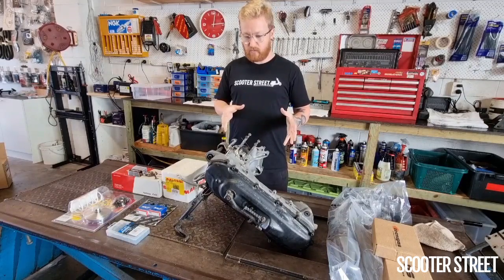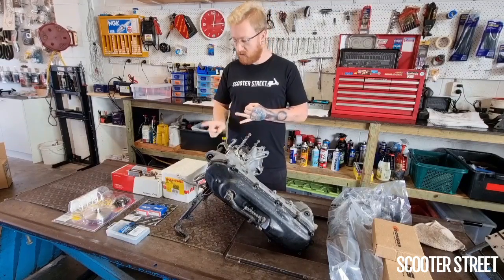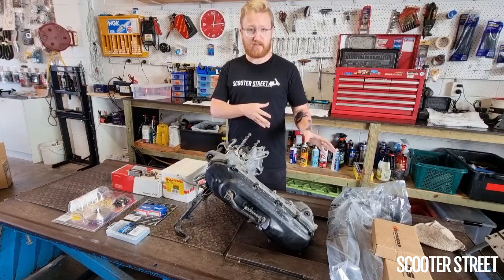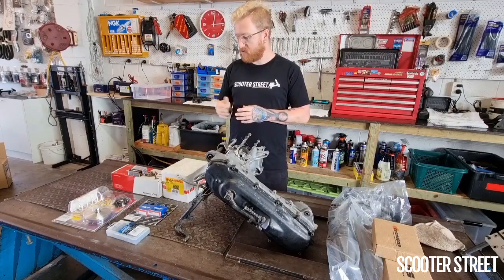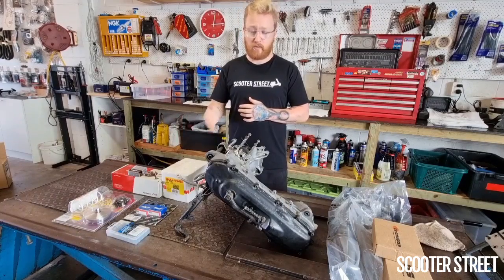So we're going to fit all the parts. I'm gonna replace the crank. While we're in there, we're also gonna do a Velocity 70 kit. Got a Technigas Next R exhaust as well. And just a Molossi variator, and then the appropriate tuning parts for that, as well as the jets. Obviously, I'm going to do the crank seals and bearings while we're in there.